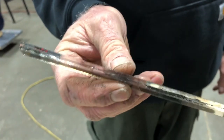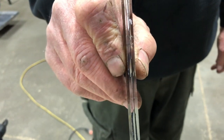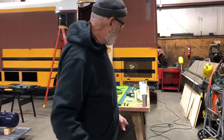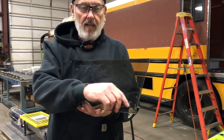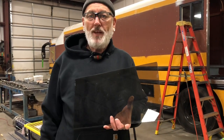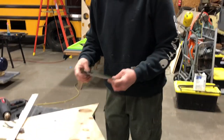Now you can see the two layers. What's really cool is if you look at it edgewise, you realize the glass is actually clear and the vinyl layer in between is what's colored. If you're having trouble and don't know what kind of glass you have, try reading the label - on automobiles every piece of glass has a mark on it to tell you what it is. If it says 'laminated' right on it, that's a good clue.